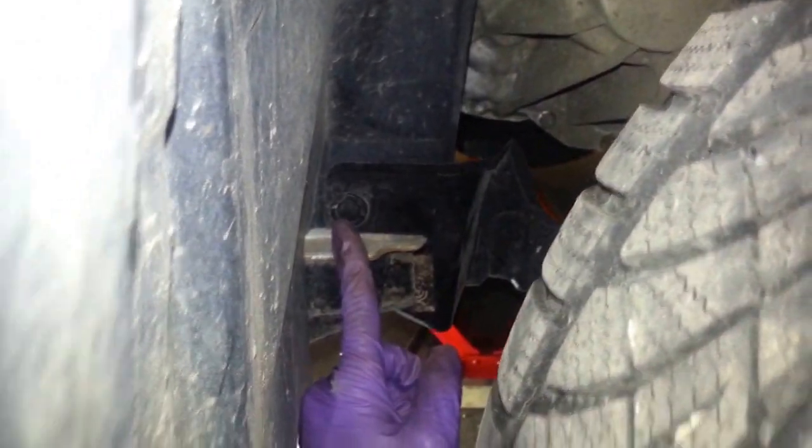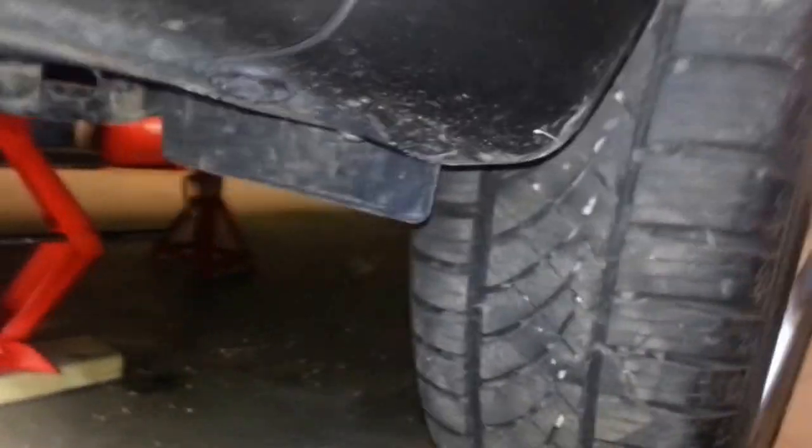And the fasteners: there's one screw, so that's the middle of the bumper right there. One screw right there. Then a 10 mil head bolt right there. Two other screws right there. Another 10 mil bolt. Another 10 mil bolt. Sorry if I'm going too fast. And then one way down here. And then there's one of those plastic tab things right here on the side, right over there where my finger is. So that's how you take that off, and then fasten it with the fasteners there.